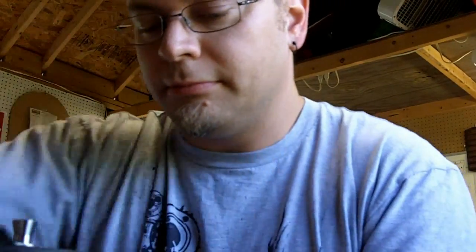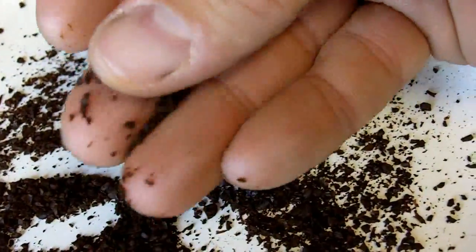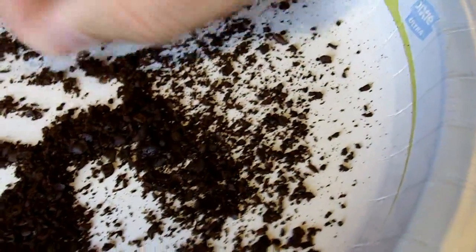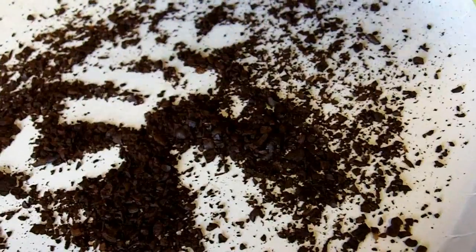I'm going to show you an example of this — we'll put in a scoop of coffee and give it a whirl. You can see it chewed through that coffee a lot faster than the first time. Now look: you see these huge pieces and then the little fine pieces? This is similar to what you get out of your classic whirlybird blade grinder. Look at that — there's a huge piece, and then just fine grounds right next to it. We end up with some fine, some mid-ground, and some really coarse coffee, all from that burr being a little off-center when you rotate it.